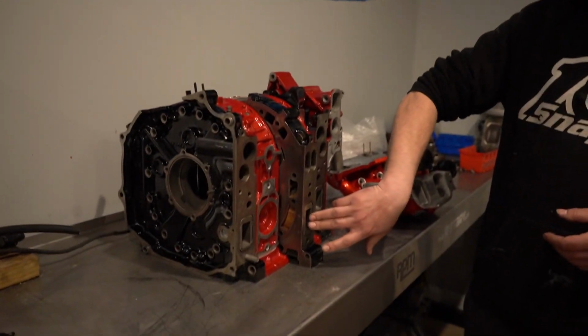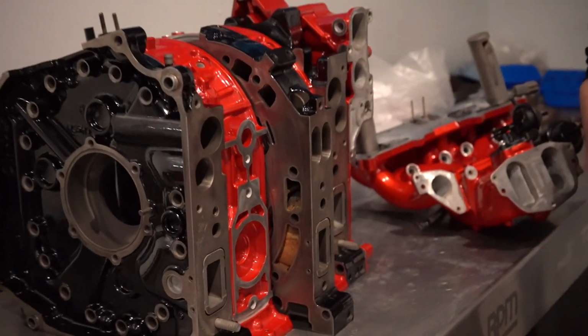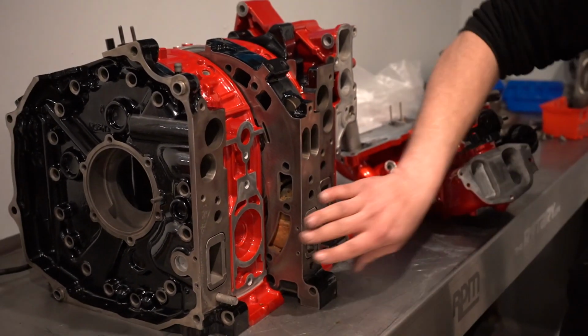I think it'd be a fun project. What we're going to do is start here, and over the course of this year, I've got 2 more engines lined up for this. Of course, we'll sell the old motor if someone is interested in the older one with a refresh, but we'll know exactly what it makes, how reliable it is, how the seals wore in the motor, you name it. The biggest one is going to be finding out about that center exhaust port, and if eliminating it is going to make things better, or maybe cause some premature failure issues due to uneven firing of the exhaust.